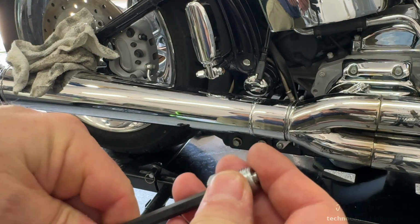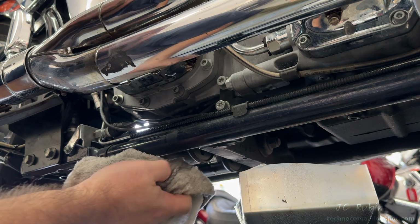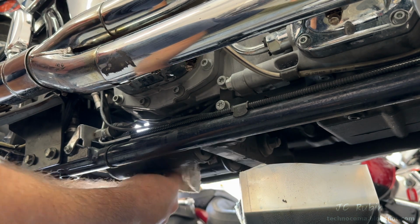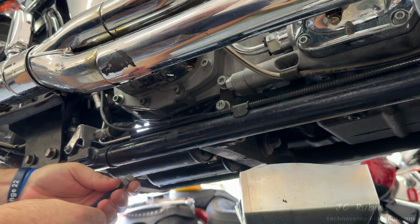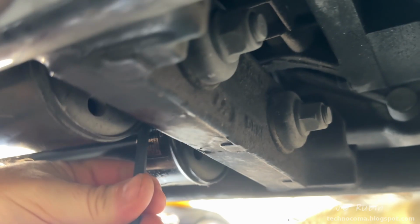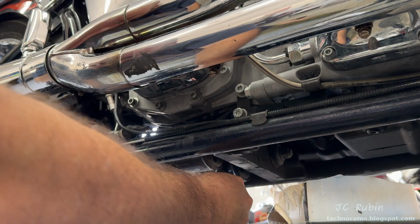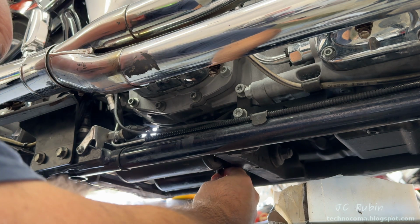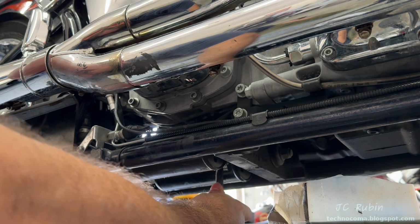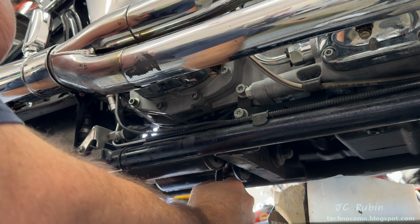And with a 1/4-inch Allen key, I'll install the plug. This is how I actually should have removed it. Squeezing a towel up high enough between those 2 shocks just to clean around that oil port. Inserting the oil plug with the Allen key, I'll screw it all the way in, finger tight. Now I could switch over to the socket and torque wrench if so desired to torque down the bolt to the final setting. Remember, it doesn't take much torque. If you're using a torque wrench, it's between 14 and 21 foot-pounds. That's it.